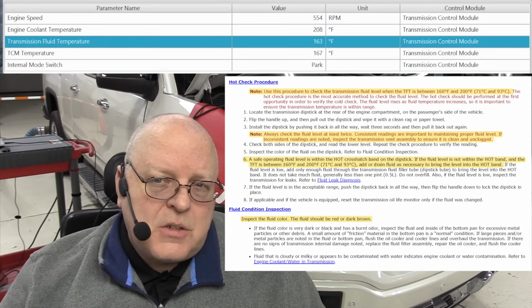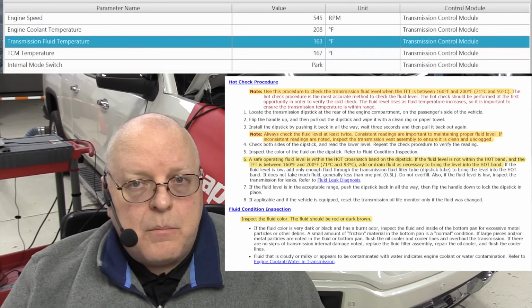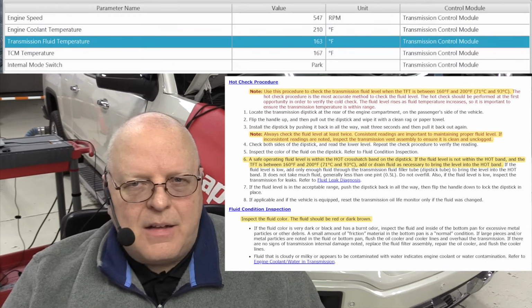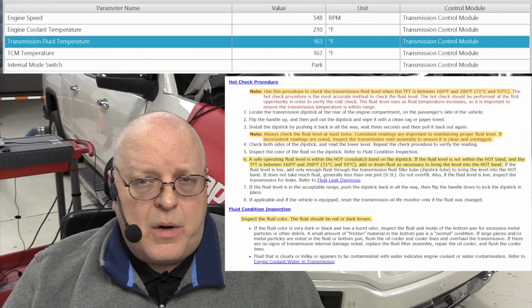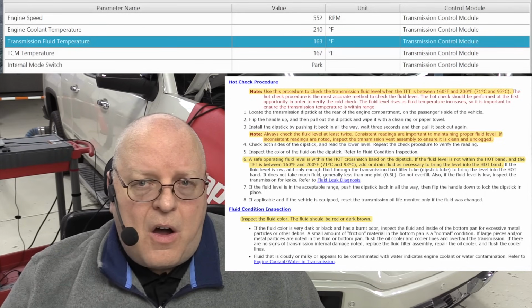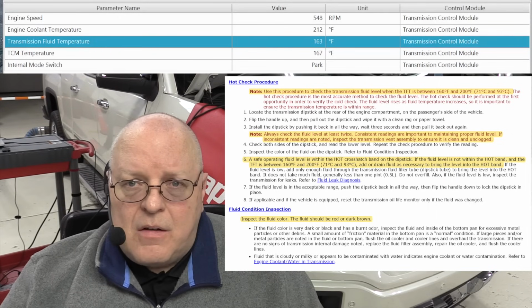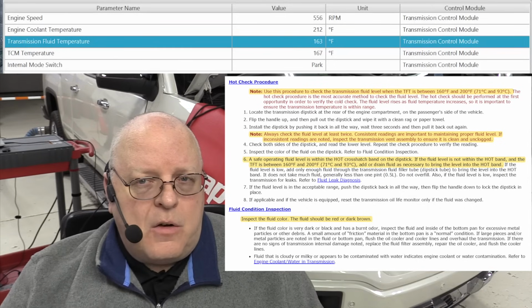So we are pretty much unchanged, as you can see here on the dipstick, from about 144 through 160 degrees Fahrenheit. But fluid expands as it gets hot, and normal driving temperature of this truck for the transmission fluid is not 160 degrees. It would be at a minimum for light load driving, but you put much of a load on it at all and it can easily hit the 180 to 200 degree Fahrenheit range. So if you had a dipstick level that showed it to the top of the hot mark, when you're at the minimum temperature of 160 degrees, you can be pretty sure that it's going to go higher than that upper fill mark as the transmission fluid temperature increases towards 180 and 200 degrees. So that would be an overfill condition.